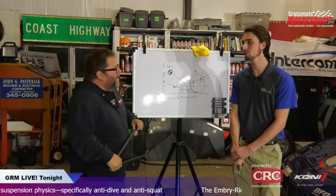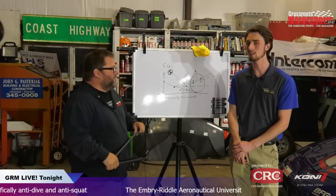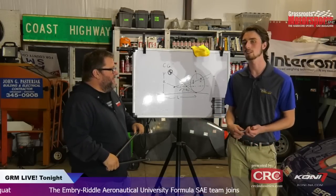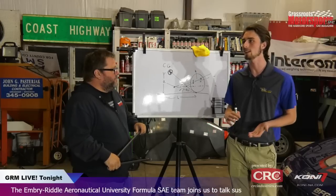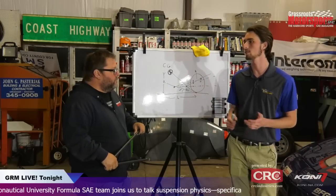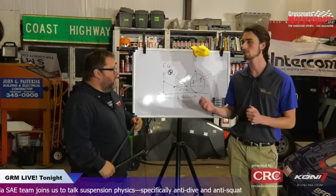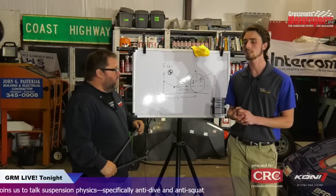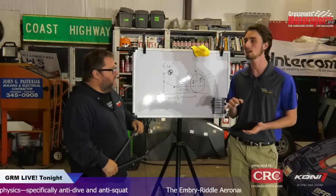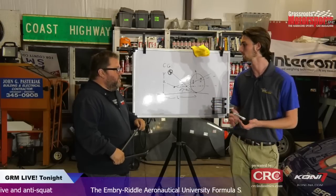That's actually why next year we're hoping to go to lower profile tires, so that they're a little more predictable. But we do get tire data from CalSpan. They test the tires on a tire testing rig, and so we can see stuff like that. It's not linear, obviously, but we can get a spring rate for the tire and model it as such. It has hysteresis damping in there and all different stuff like that. So definitely tires can make things a lot more unpredictable, and the lower profile tire you have, the more predictable it is because it moves less.